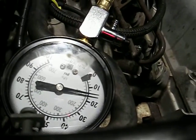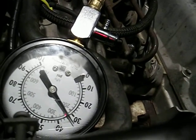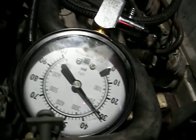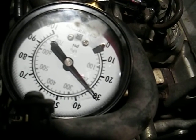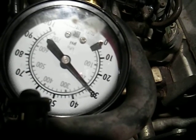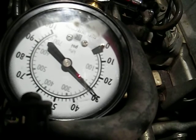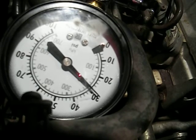See that 40 right there? Ready — boom — I turned it on and it went up to about 38, and now it's bleeding down. We're going to time this and see how long it goes. My concern is that this bleed-off is too fast. Frankly I have no idea what 'too fast' is, so I was looking for help from anyone who knows more about fuel-injected cars. The pressure came up pretty quickly, I'll give it credit for that.